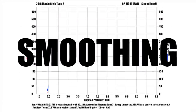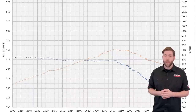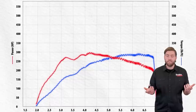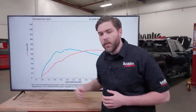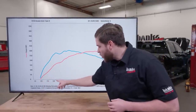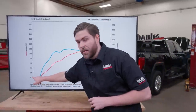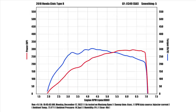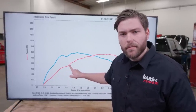Last but not least, we have the amount of smoothing applied. Smoothing is the amount of noise correction applied to the lines on the graph. A dyno graph with no smoothing will appear jagged, while one with lots of smoothing applied will show a more even curve. Most dyno operators use smoothing because jagged lines are confusing and often concerning to look at for the untrained eye. Now let's take a look at the graph itself. Here we have RPM on the x-axis, with torque and horsepower on the y-axis. As the dyno takes measurements at each RPM increment, the torque figure is plotted and ultimately gives you the torque curve. But notice how this curve does not start at zero RPM — commonly you'll see the graph start around 1,500 RPM, so you don't lug the engine during a sweep. But remember, dynos only measure torque. So how do we get the horsepower curve?